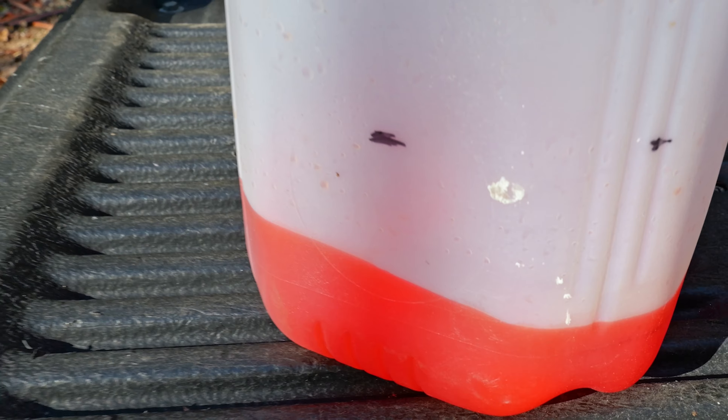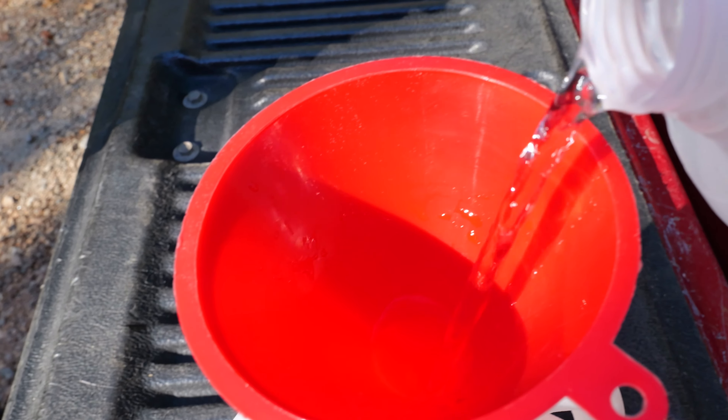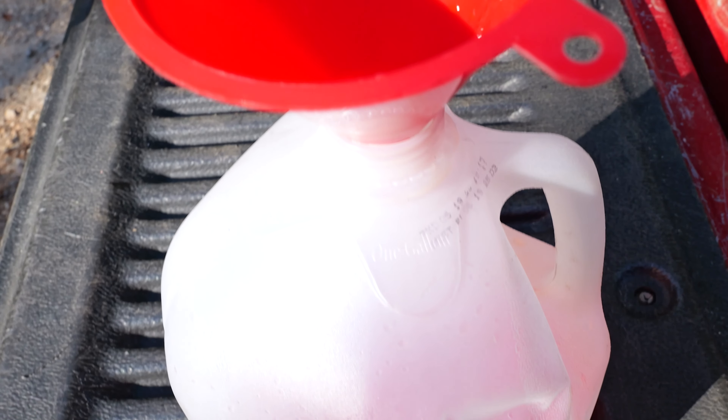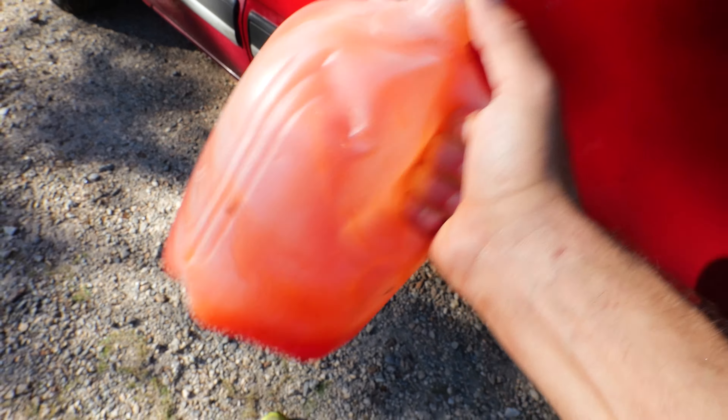What I do is normally mark it — half here, that's 50. Come up with some water to meet our line and we got a 50-50 mix. So we get some distilled water in here. We always use distilled water when we do this for the radiator. There we go, we're getting it mixed up. Shake it up, get it mixed up — 50-50.